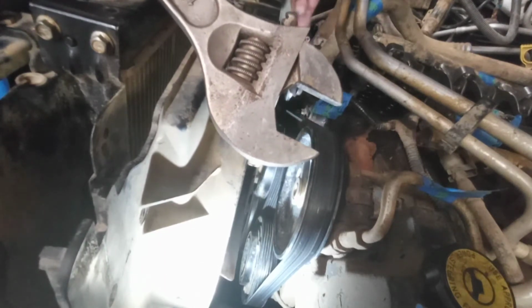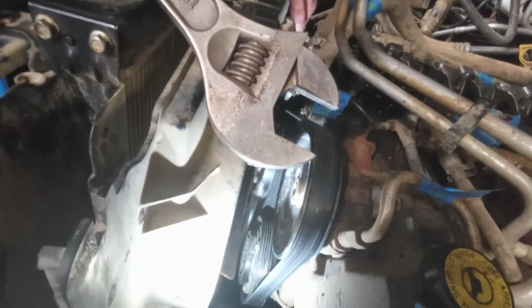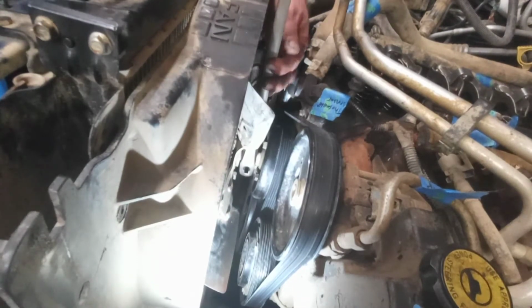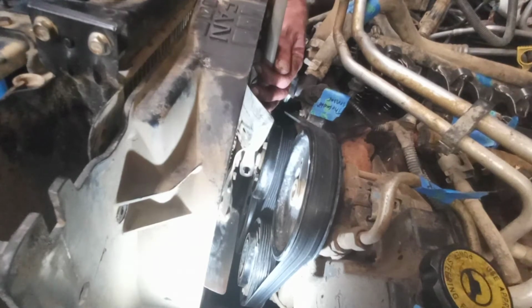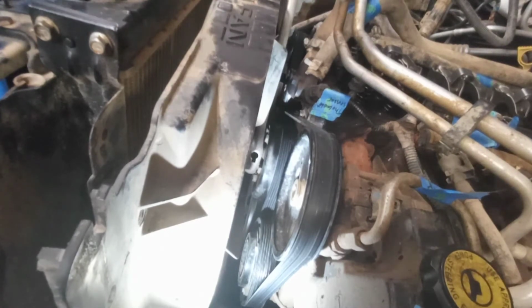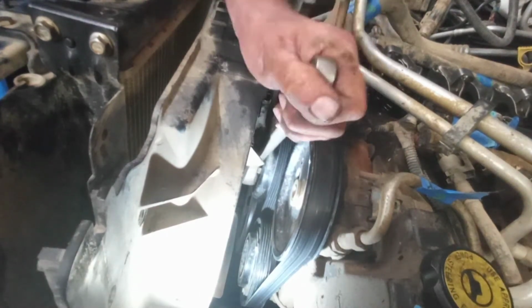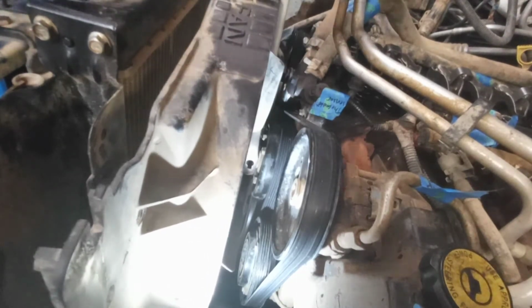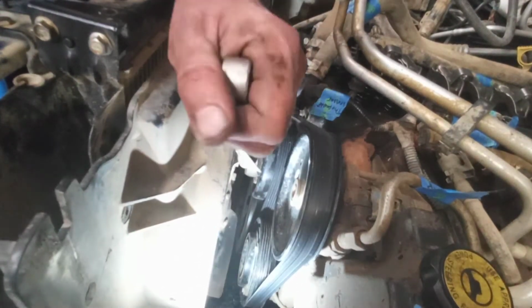And spin your fan blades, because these fan blades are offset, and there's more room between some of the sets, quite a bit too. So I'm going to get under my crescent wrench and give it a whack with a hammer. This is how I've always done it before, and I've had this part off a lot of times. Just do it like a shock hit that will crack it loose, because it is going to spin on you. Quick and hard. They usually pop right off for me.